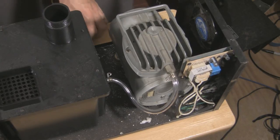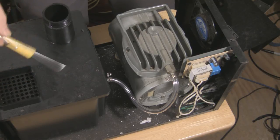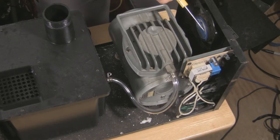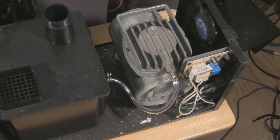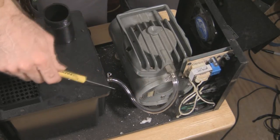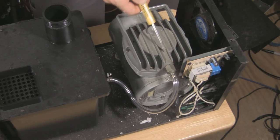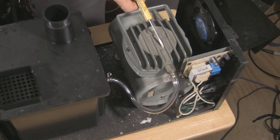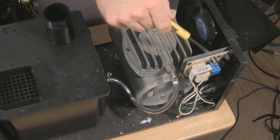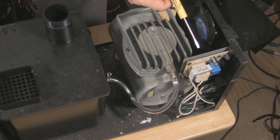Now, before I put the lid back on, I want to point out this device is so simple that you can really easily troubleshoot. The only moving parts: you've got this DC brushless fan that pushes air across the unit over the oil tank and pushes the haze out, and the air compressor simply pumps air into the tank. So if you're not getting haze, there's only a couple of things that can go wrong. It's easy to repair this compressor and you can buy a brand new one. The circuitry is really simple — if you think it might be the circuitry, make sure the unit's unplugged, look for loose solders, broken solders, or rusted components and replace them. Make sure all these wires are tight where they join into the circuit board.